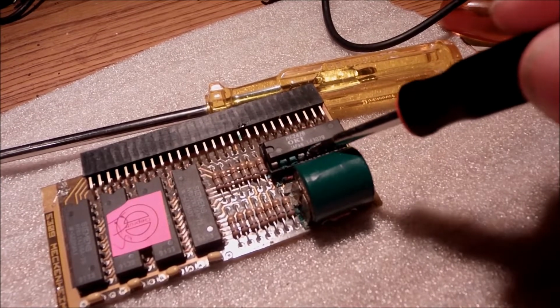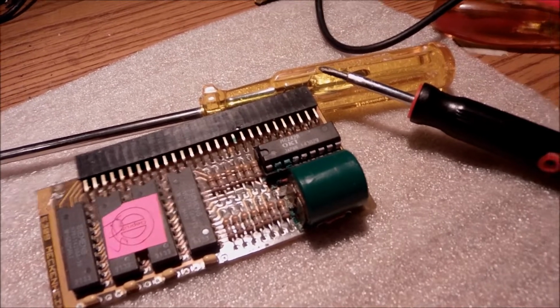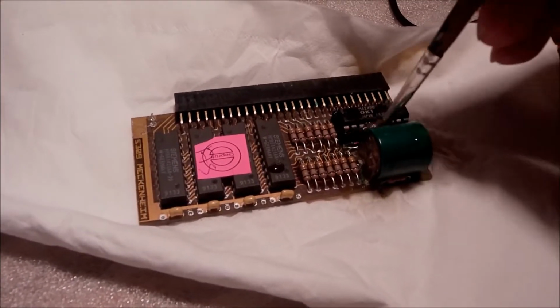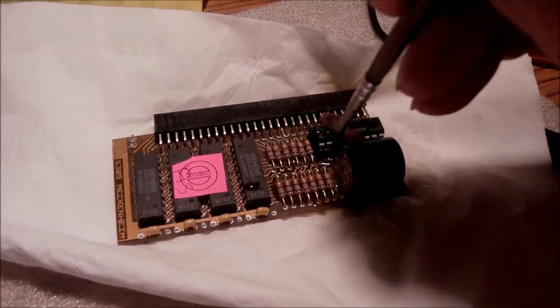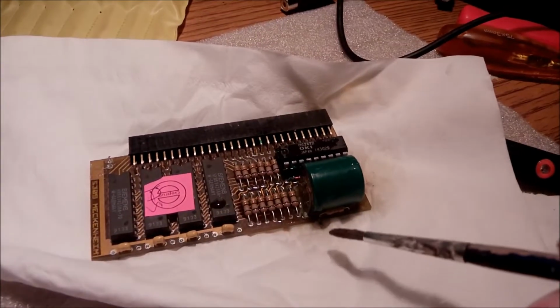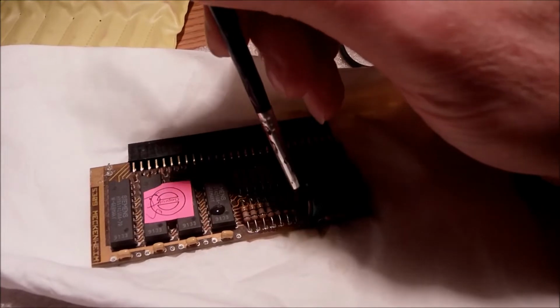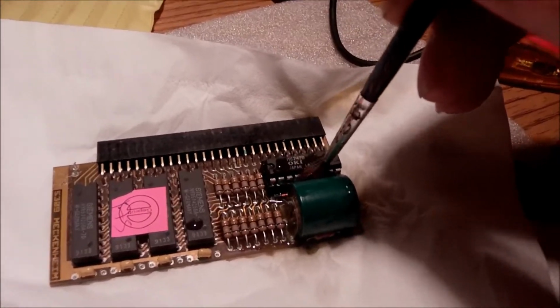This whole part needs to be cleaned thoroughly. I assume the mold has got inside the IC pins also, but the domestic recipe never fails. So vinegar in this case, and a little tiny brush can clean up the components and neutralize the acid, and prepare the ground for further cleaning with some alcohol. After all, I'm going to remove the chip in any case and see what is going on inside the socket.